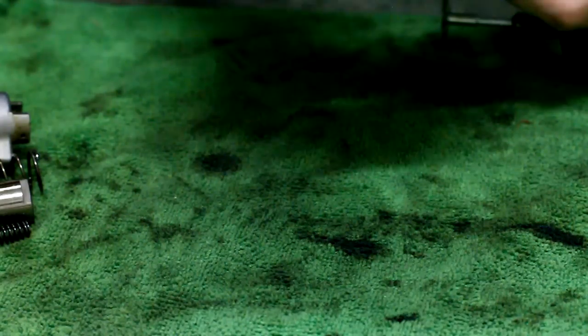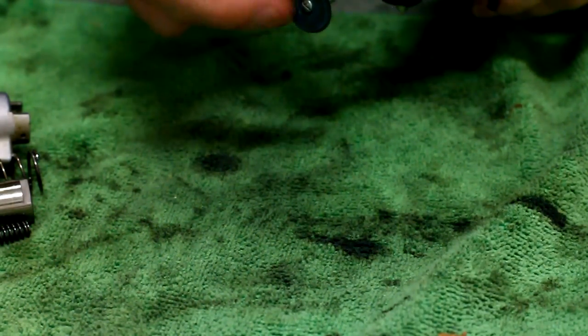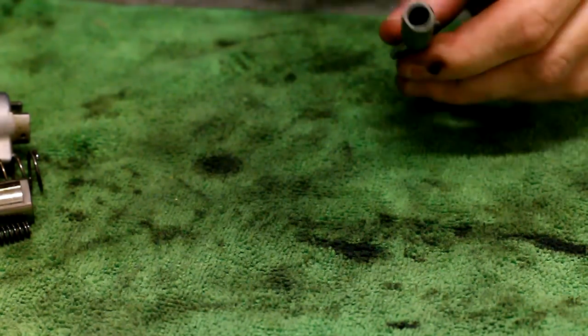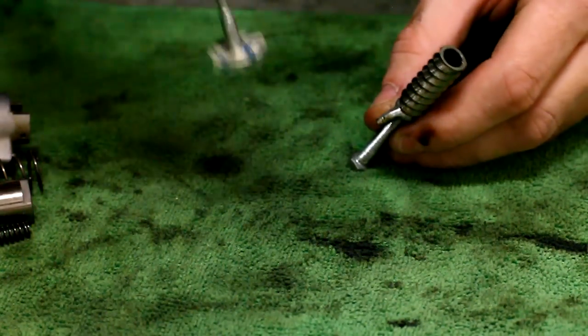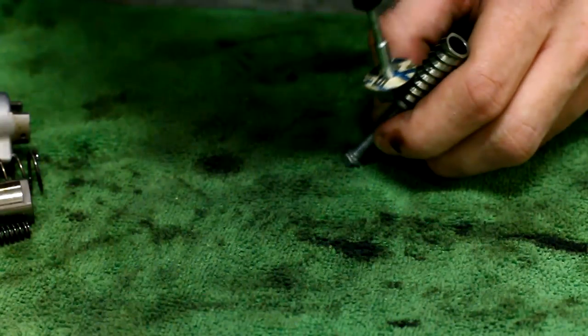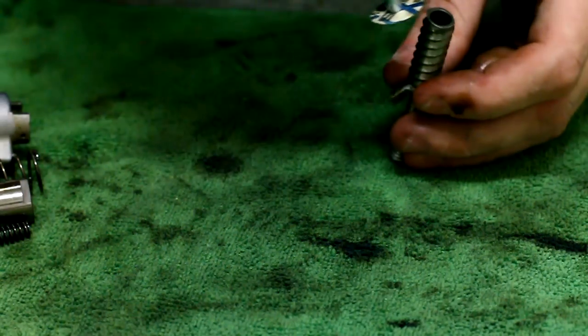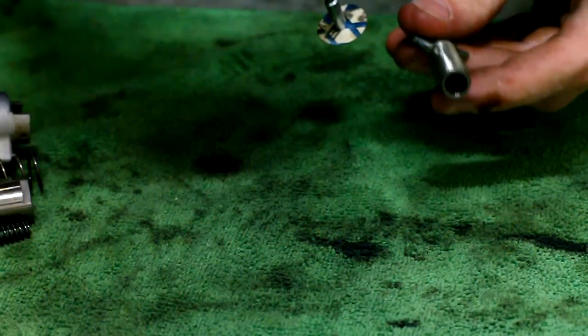The teeth get too smooth — they don't create enough friction with the oil surface to put pressure on the plunger and push against the timing chain tensioner to keep it tight. And that's what you hear: the chain rattling left and right. So all we're going to do is knock this surface back off. With the Dremel and that 80 grit sandpaper, you're going to hold it up and take the Dremel on medium speed. The main idea is with the disc facing up, you walk that disc down and turn this piece to get all of this surface. The bottom surface does not matter — just this top surface. Work it back and forth until you have a rough looking surface all the way around.